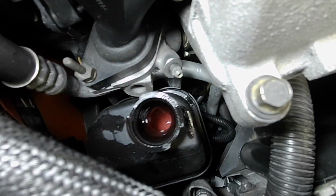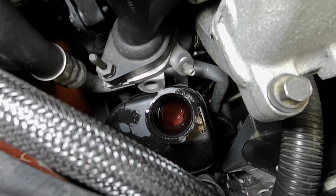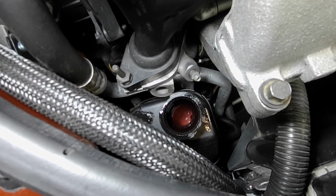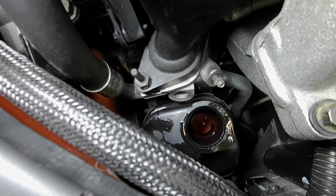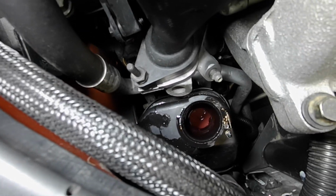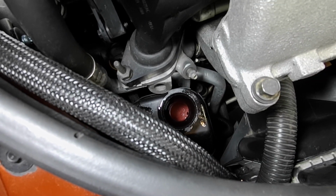See what I mean, guys? It gets like that pink foam in there. So if you see that, just give it a break. Let it sit for a while. That'll clear up pretty quick, and then you can go again. That is actually progress. Those bubbles will all rise up out of there, and you'll be getting rid of that much air out of the system. I'm going to top that up a bit too, because it is a bit low.